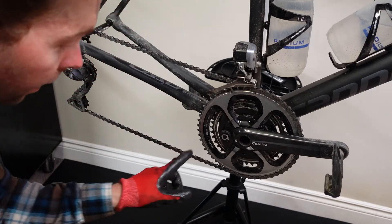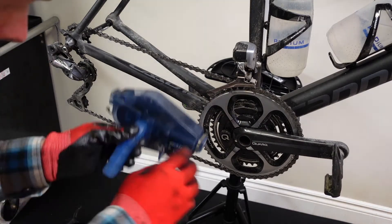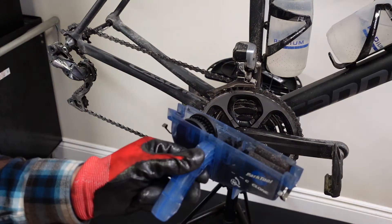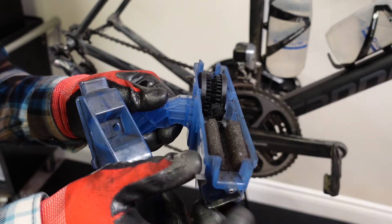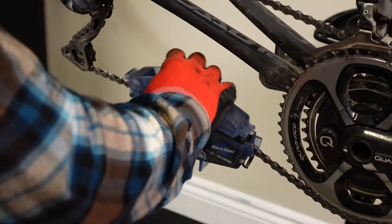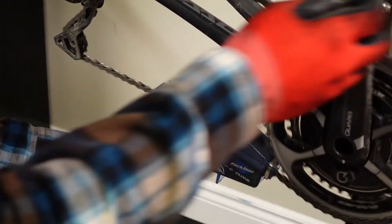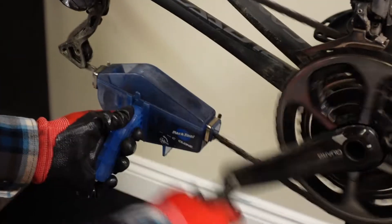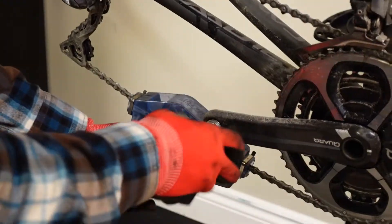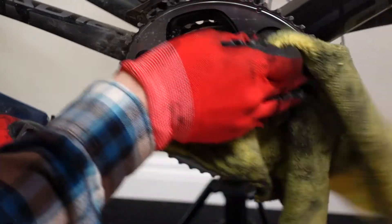What's important here is that the chain is level with the ground, because when you put your cleaner on it'll spill out everywhere. There's a fill line right here — you fill up the degreaser to that line, that's how you know you're level. It has these little latches and it just goes on the chain like so. So what I like to do here is put it in the little ring for a bit, and while it's in the little ring I wipe off the big ring.